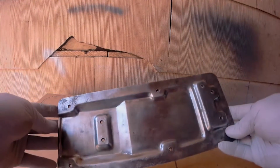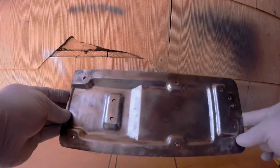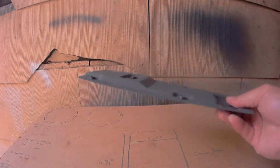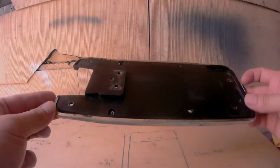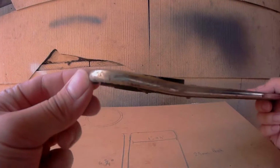So I went to get the metal bracket, and notice it had new rust forming. That was due to the oils on my finger, so I cleaned it up again with a wire brush, and I primered it completely. Now I have one final issue. The shiny trims here have residue left from the tape that was used to hold the center console piece together.